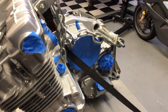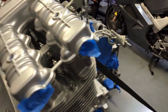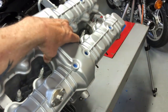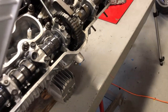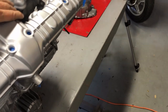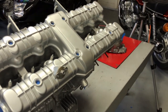I've taped up the areas that I don't want to have paint on. Sometimes you don't have to get real precise — you just cover it up because you're really just going to fog over it. I've cleaned up the valve cover and painted it, but before I put it back on permanently I tape up the holes from below so that the paint doesn't get down inside the engine. Then I just lay it on top so the paint doesn't get all over the cams.